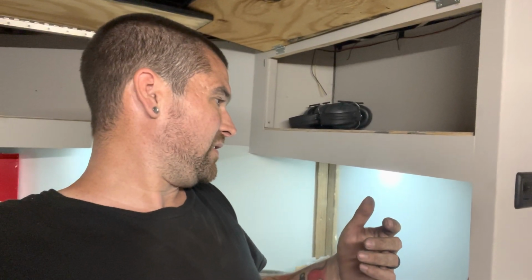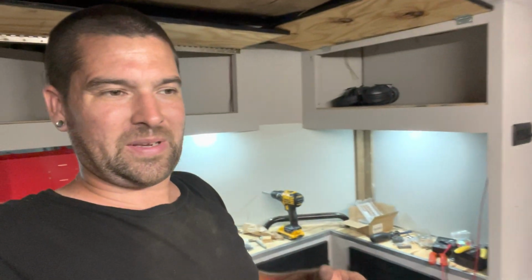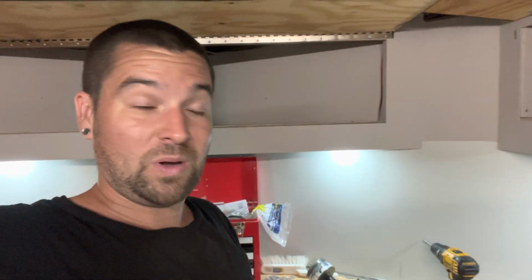And then when you hook a wire to the top of the switch, the other end of the wire doesn't have hardly anything. When it was down there, strung across the trailer, it had nothing. I bring it all back here, clump it up on the floor, and I'm getting anywhere between 1 point something and 2 point something. So I'm really thinking this wire is bad.